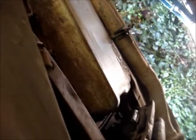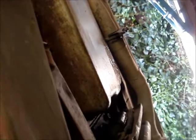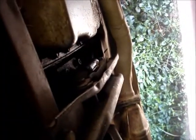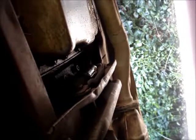Hey guys, well today I'm under the car, about to do this transmission oil and filter change. Now there's no drain bung on it, so you drop the sump off the transmission very carefully, then tip it out. Best way to go about it is to take all the bolts out but leave one in each corner, but you only have them in two or three turns.